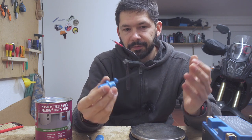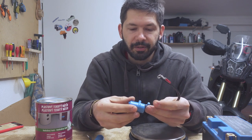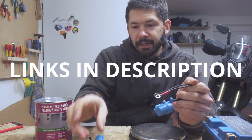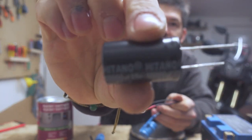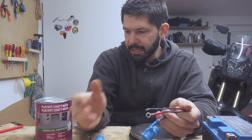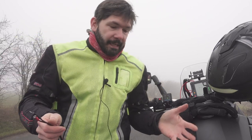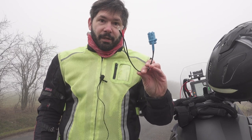This is only relevant for fuel-injected bikes — bikes with a lot of electronics. So I took these and tested it, that's the second section of the video. There's a good tutorial on how to make this. I used really cheap 10,000 microfarad capacitors — you don't need anything else — and a plastic enclosure from a DIY shop. What I'm going to do is push-start the bike with the battery first, then replace the battery with the capacitor and see if it works.